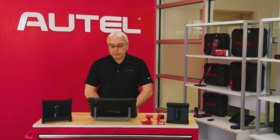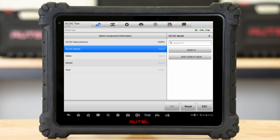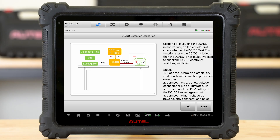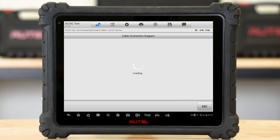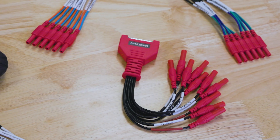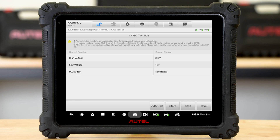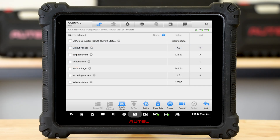The next component test available to us is the DC-to-DC converter test. Much like the compressor test we just saw, I'll go ahead and select the type of manufacturer that makes the DC-to-DC converter for this vehicle. Again, we have our options: the DC-to-DC converter can be tested on the vehicle or off the vehicle. I'll just follow the directions on the screen — we have them all listed out for us. The cable connection diagram is going to show me a picture of the DC-to-DC converter and the plug that I need to back-probe with our universal pinout tools. So now we have the ability to test the switch side of the circuitry from the car side and also all the internal electronics of the high-voltage component, right here through our EV tablet.